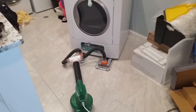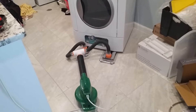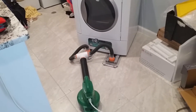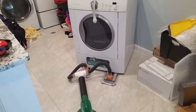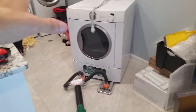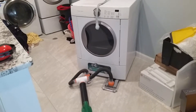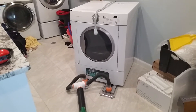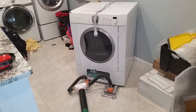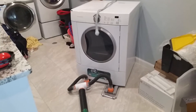Move the dryer easily with one hand. That's directly on a tile floor and I didn't use anything underneath it for lowering the friction — that's all done from the air exiting the bottom of the feet. I probably could use either a thin board or another piece of vinyl or some plastic to make it a lot smoother and less friction. If I push on the top of the washer I tend to collapse the feet a little bit, so it kind of rocks and then it grabs. But if I push it lower near the center of mass it slides around quite easily. Like I said before in the previous part, I am very pleased — the idea actually does work. Now I just have to see how it performs on the washer and what I have to do to improve it to make it actually work for the washer. Thanks for watching.